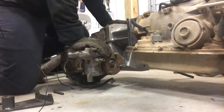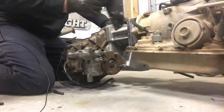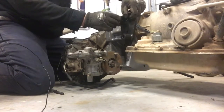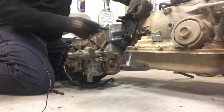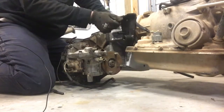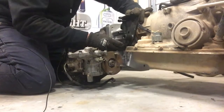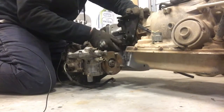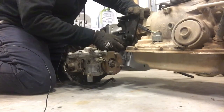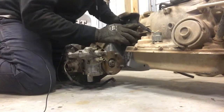One step that Advanced Adapters gives you is this bracket here — it's part of the linkage for the four-wheel drive. I just grabbed some bolts and we'll put it on here. What they tell you is that for the 4L60s like we're using here, you have to trim for the hex style housing of the 4L60s, but they don't tell you how much to trim or anything like that. So I'm basically throwing this on here real quick to get some markings to see about where we have to go to get around the 4L60 portion here.